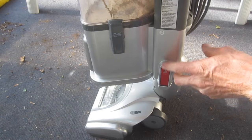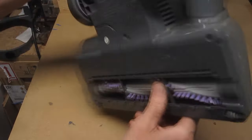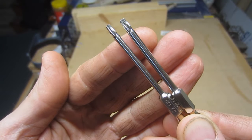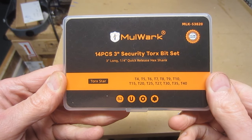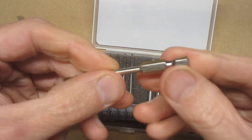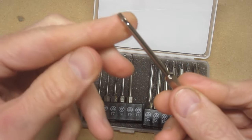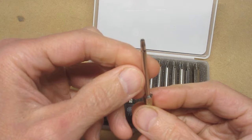For convenience, I first separated the motorized floor brush from the rest of the vacuum. Disassembly of this unit does require some specialized hardware, specifically Torx Star Security Bits T10 and T15. I didn't have any of these in my tool collection, so I picked up this set on Amazon. What I really like about these is the quarter-inch hexagonal shank, the three-inch length, which is more than adequate for accessing most recessed screws, and the fact that they're magnetized.